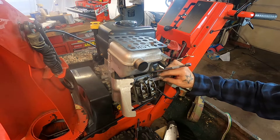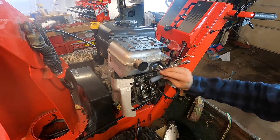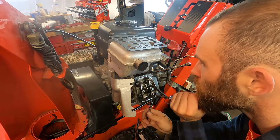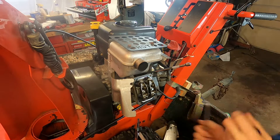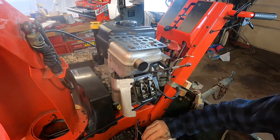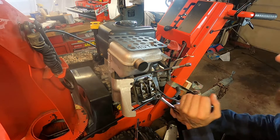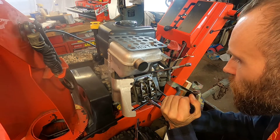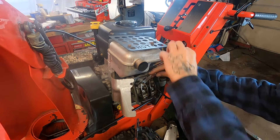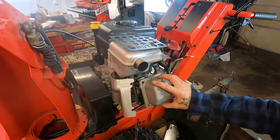I think it loosened up. Let's tighten her an eighth of a turn. I like that — I like that a lot. You feel just this little bit of resistance. Without further ado, make sure we've cranked all these down without over-tightening. Do a last check — three thou over here, five thou over there. Still feels real good. Pull that guy out. Valve cover on.